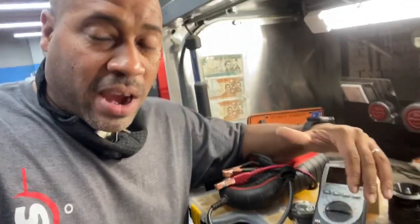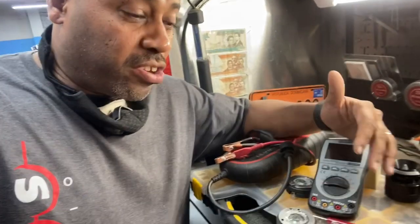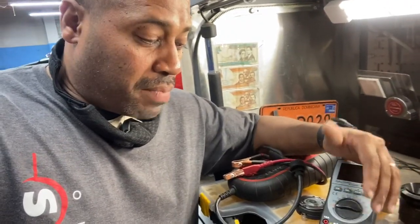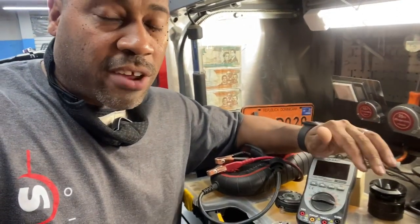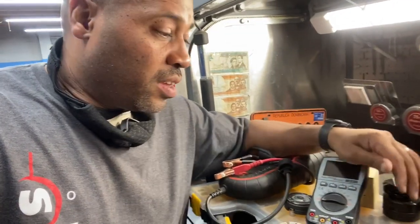Just make sure you protect — these things only need 25 to 30 watts maximum. So if you're going to run them in parallel, especially if you're bridging a big 4-channel amp, make sure the tweeter's not getting too much energy. This actually blew out the tweeters that come in the Hertz High Energy 6 line as well, so we're going to have to swap those out too.